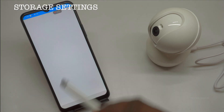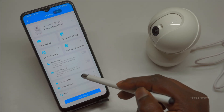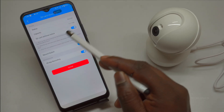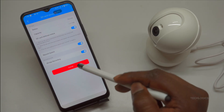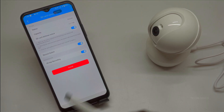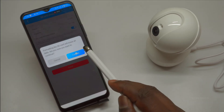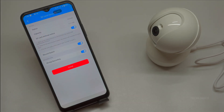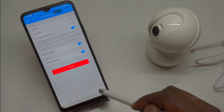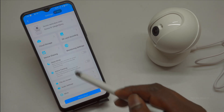On this initial visit, a pop-up screen may automatically appear asking you to configure the storage option — the app detecting your inserted microSD card and preparing it for recordings. If the storage prompt doesn't appear automatically, manually check it by tapping the camera settings gear icon, then select SD Card or Storage from the menu. Here you'll see the card status, e.g., uninitialized, and an Initialize or Format button. Tap it to bring up the formatting screen, ensuring your card is fully ready for saving motion clips or continuous footage without errors.